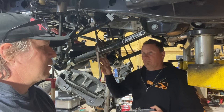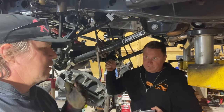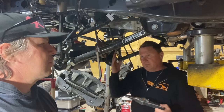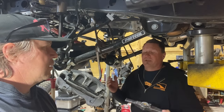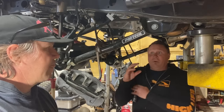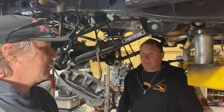And the ring gear pattern, what we're looking for is a centered ring gear pattern between the root of the gear, the very deepest part of the ring gear, and the top of the gear, which is the highest part. We're looking for a centered pattern. We're looking for no sharp edges. One way I heard it explained recently, and it was a great idea, it should look like a little hamburger bun, like a football. Okay.